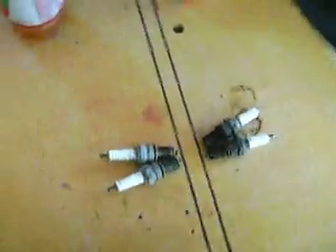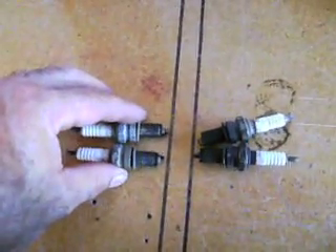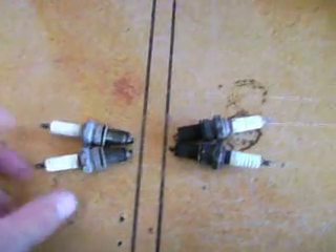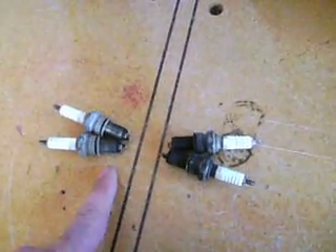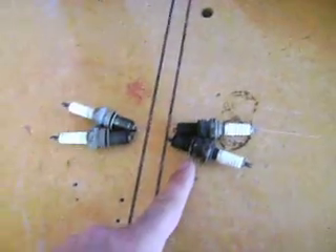What motivated me to do this was fairly simple. I was performing an oil change and tune on the Thundernuts bike. By looking at the spark plugs — this was the front cylinder, this is the rear cylinder — you can see there is an imbalance between the front and rear cylinders. There are two plugs per cylinder, and this one is running a little bit richer than that one. So I wanted to trim back the air-fuel ratio on the rear cylinder to get them to match and run closer together. That's what motivated me to run these cylinder trim value tests.